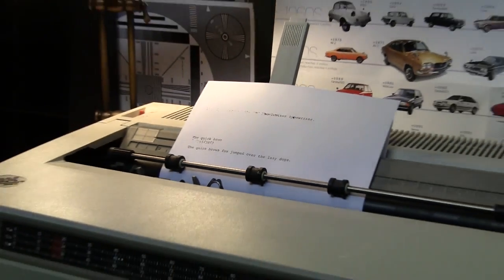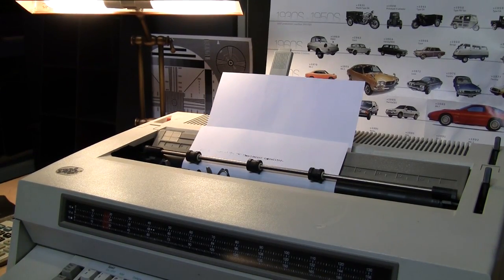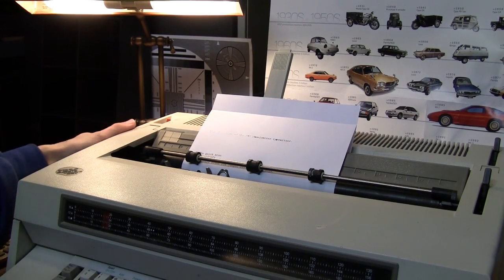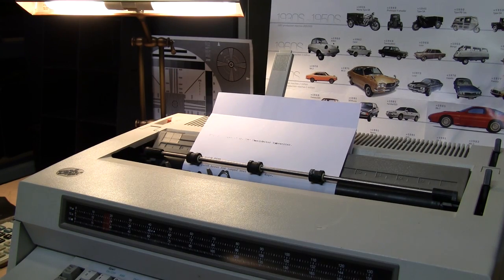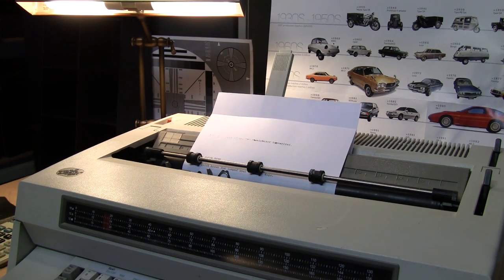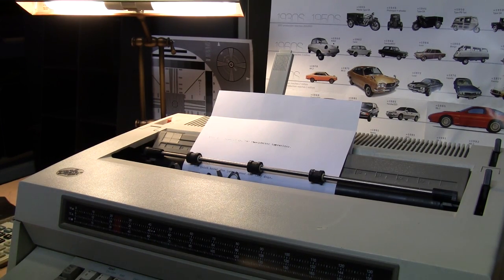You may have noticed there is no roller — that's because you use the arrow keys to move the paper up and down. Sometimes I actually prefer having a roller, but using the arrow keys is perfectly fine. You can move it in micro adjustments: if I hit Code and Micro Up, it moves the paper up in very small steps. Code and Micro Down moves it down in very small steps. You can also backspace in micro spaces by holding Code and pressing Backspace, which moves it in increments smaller than one character.